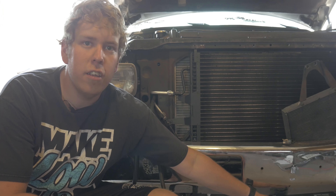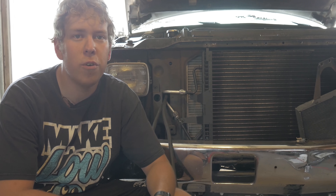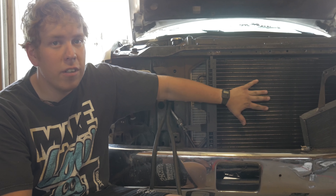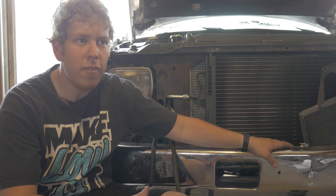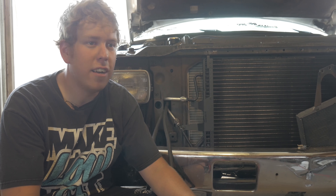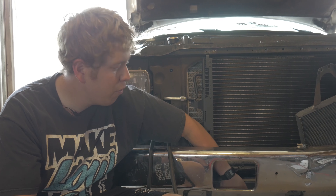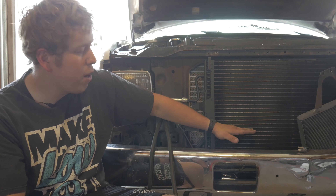Ideally, you're going to want a front hitch for your truck — it's going to make the location of the transmission cooler actually work for you. If you mount it up here completely in the air, which I did in an emergency on the road with close to a 20,000 pound load, you're going to start to get really hot. So what you want to do is actually mount the bottom of the cooler all the way down here, and then the top is only going to come to about here.